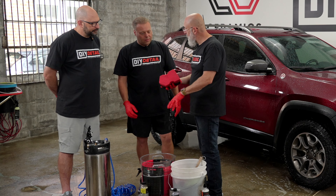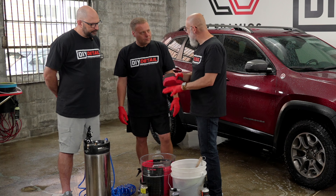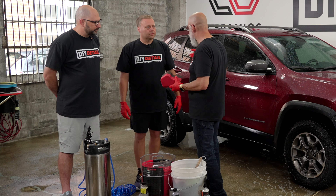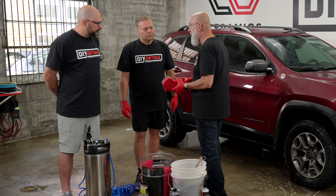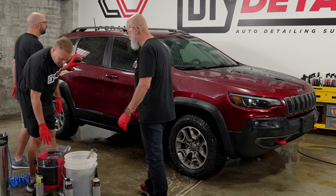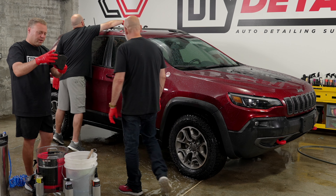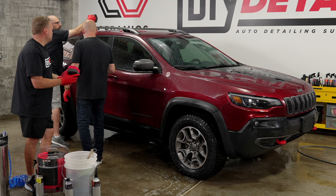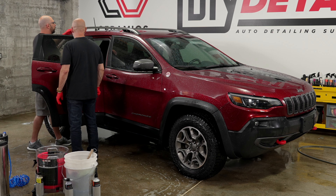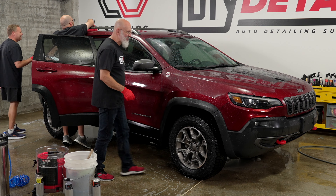People on my channel — yes, I'm wearing gloves. This is something you really never see from me before, but I said I couldn't be here if I didn't use gloves. You should always wear gloves when detailing — if you read the comments in Keeve's channel, you'll often see Ivan commenting that you should be wearing gloves. This is a keg-based sprayer. These do really well because you fill a lot of air and get a lot of spray time out of it. I also use a Fantic sprayer, a two-gallon sprayer that pushes about 100 PSI, to help knock stuff off if you don't want to use this rinse method.